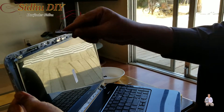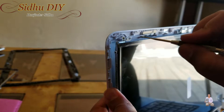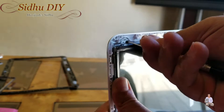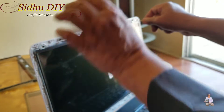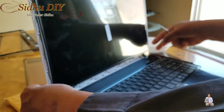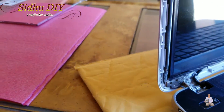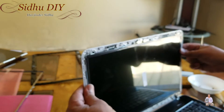As we bring it up, we align it. There are small tabs — this tab is going to go into this hole and we're going to put the screw in. The same scenario is on the other side — it's like a guide pin. Make sure that we put the screw in and tighten it. This guide pin goes in there. Once the screws are tightened on both sides, we're going to put the screws on the bottom as well — two screws here and two on this side, one on the top — that holds the screen in place.